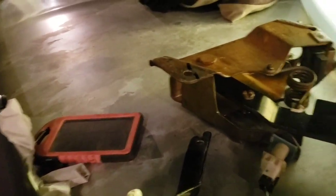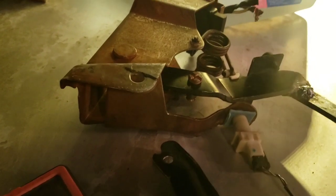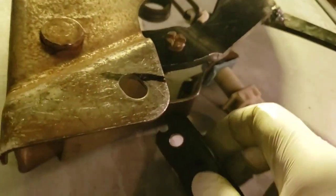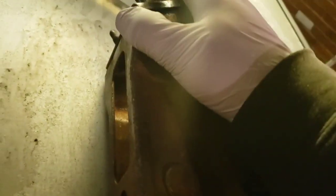This bracket piece is already braced, kind of like an angle iron. I could butt weld it around that hole, have it sit flat against the bracket, drill a hole, put a nut on one side and a bolt on the other — that gives me a proper support. The plan is to just tack it into place and stick it under the dash to see how it fits. With welding you get a lot of flexing, so I'm thinking maybe give it a little extra space on purpose and shim it with washers, so I don't put too much stress on the plastic master cylinder ears.